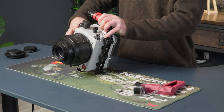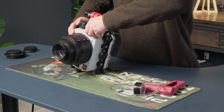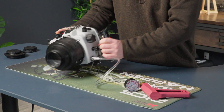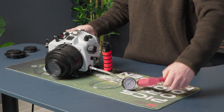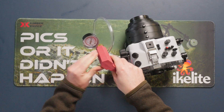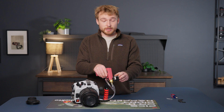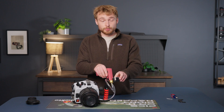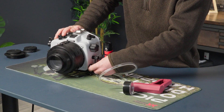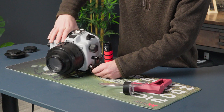It's very simple. On the side of the housing, you'll see a vacuum valve. Click the button to release the cap, and place the barb inside the valve. Then start pumping. I've pumped mine to 10, but the number you pick isn't as important as making sure that the needle doesn't drop. Once you've pumped it to your desired number, remove the barb from the valve the same way you put it in by clicking that button, popping it out, and replace the cap.